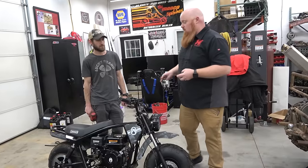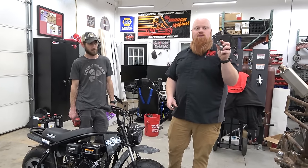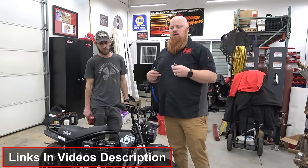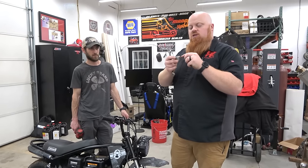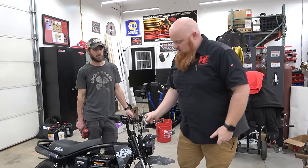Yeah. So now that we know we got more low end, we're gonna pull out these forks, and I've machined up some spacers. We're gonna be selling a kit to do a 2-inch lift. The only thing, like I said, you're gonna have to buy shocks from Amazon. We'll link them down below. They're 11-inch shocks. We'll put different varieties down there. But these are the same bushings we actually use for our swing arm. I just cut a 1/4 inch off of them. So these are 1-inch. So we're gonna stack two of them inside there.